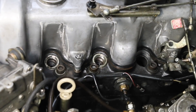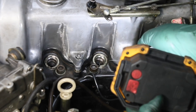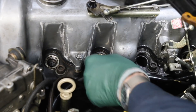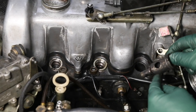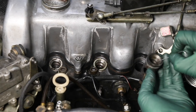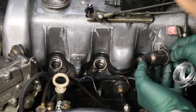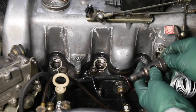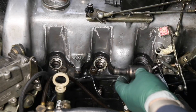Now I'll take my wire. This is, once again, to make sure the tip isn't blown out because you can't see this. There's the ball right there. So you have to go in and go around the ball, kind of put a little hook on it, and then you shove the wire down in there. It's very unlikely you're going to be able to shove it through one of these holes here. But if that wire keeps going, it's a pretty good indication that you've got a pre-chamber that's blown out.